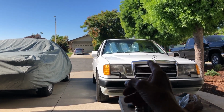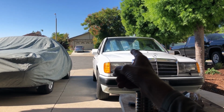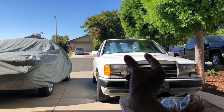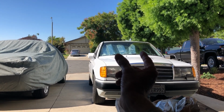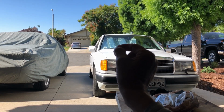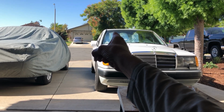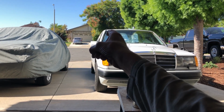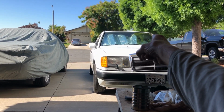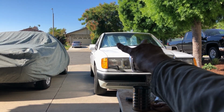Okay, the coolant temperature sensor, when it goes up to a certain temperature, 105 Celsius and above, it's like a switch. It's called a switch or a sensor. And when it closes, it completes a ground circuit or something. And through a wire, it's hooked up to the climate control unit. The climate control unit says, oh, overheating. And then it sends that ground signal to the high-speed relay and completes that circuit in there and fires the high-speed fans.